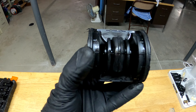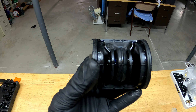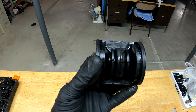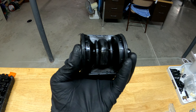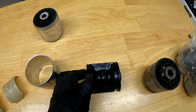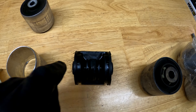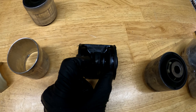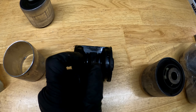As you apply the brakes, there's a tremendous amount of force and energy traveling through the thrust arm into the bushing. The bushing is going to flex in that direction towards the workbench. That rubber in the center prevents this from compressing.